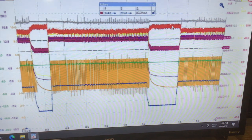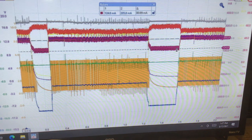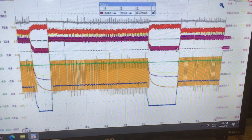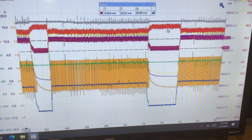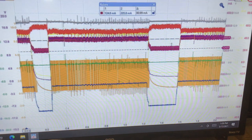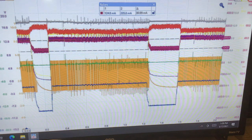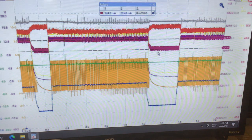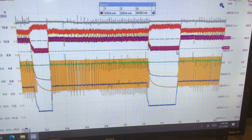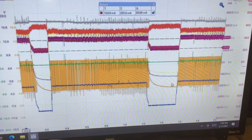I know it's a little tricky, but you get the idea, because it's basically a parallel circuit where one circuit, the ignition PGI main relay coil, is not flowing current, and the only current is flowing through the ignition coil relay. You can see that right there. Anyway, they should be the same, and they are. It's just hard to get you a good measurement. But I think you get the drift when we see no current flowing through blue, and all the current's flowing through red and burgundy, which is the same circuit. So we can see that comparison there.